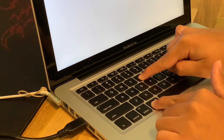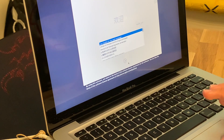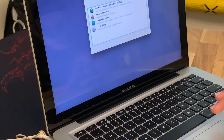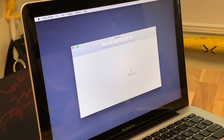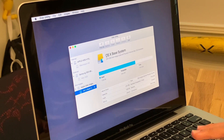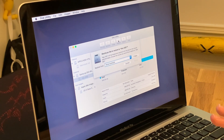Don't let go — when you see the Apple logo you can let go, but I like to just keep holding it. It's going to show the Apple logo loading screen, then lead you to the Recovery Mode menu. Select English as the main language, then it loads the macOS Utilities screen. Go to Disk Utility, hit Continue. Now you'll see not two but three drives: Macintosh HD, the Mac SSD, and also the OS X Base System — that's a safety partition Apple puts on all MacBooks in case you lose anything.